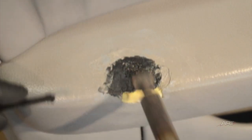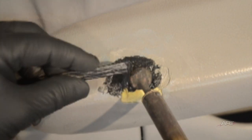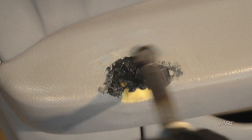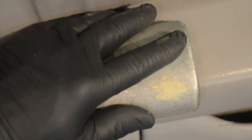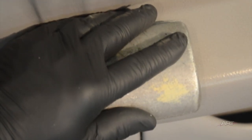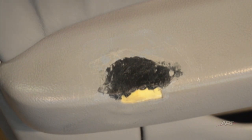As a suggestion, do a little bit at a time and allow it to cool down between layers and you'll have better control. You'll find that the aluminum chill bar helps to shape it as well as to cool it so your next step will be more effective.